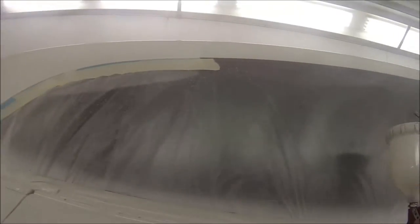You'd be forgiven for thinking — oh, high volume, low pressure, you can get away with spraying 1.5 bar or 20 psi. Well, that's not the case, because the first part of high volume low pressure is high volume, so it does get a lot of paint out. But 20 psi is low pressure compared to the old guns. They're very efficient spray guns these. Even with the clear coat, you can see there's not much bounce back, not much overspray — mostly paint sitting in the panel.